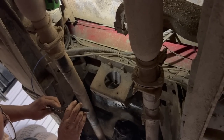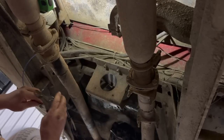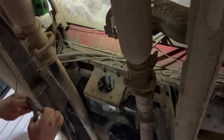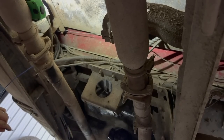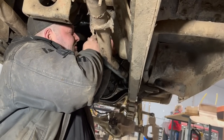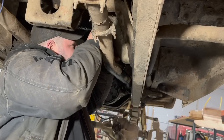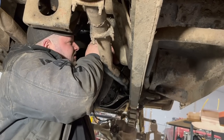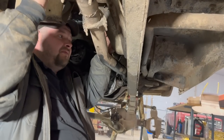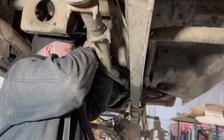We're creating a wire here for the power source for the electric fuel pump — one continuous wire. No more butt connectors, at least for that. Taking off the shield so we can get to the fuel transfer switch to take it off, because he doesn't have a second tank on, and we need it from the pump here to the steel lines over here.